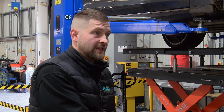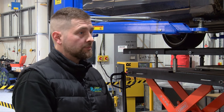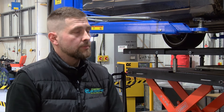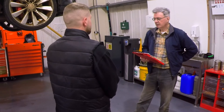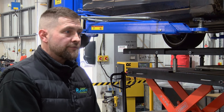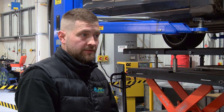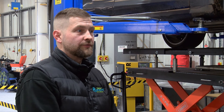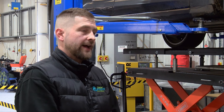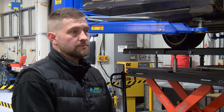I'm actually quite a big fan of the Tesla packs — they are very well put together. Most of the vehicles we've seen have done quite a bit of mileage and some have had a hard life, yet the batteries are still very strong, albeit sometimes wet and a bit corroded. So the actual individual cells are pretty good for degradation — the only weak point is water ingress? So far, yes. Lots of fast charging and rapid discharging will cause degradation, but so far it seems to be more failed electronics and water ingress causing these vehicles not to start, or causing charging and balance problems.